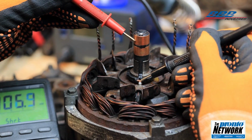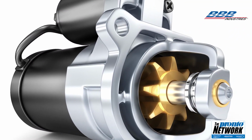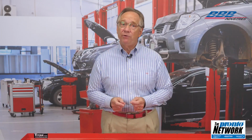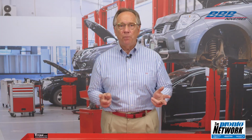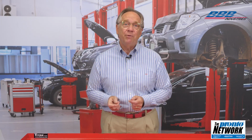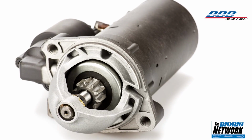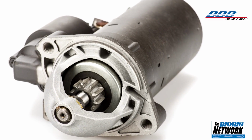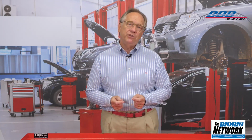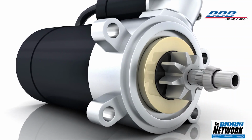Starter failures are not very common these days thanks to fuel injection, but they still can happen. If an engine won't start for whatever reason, no fuel, bad gas, no spark, or no compression, and is cranked continuously in a futile attempt to bring it to life, the starter can overheat and fail. As with alternators, the cranking circuit needs to be thoroughly inspected to rule out all of the other possibilities before replacing the starter. Starters also need to be bench tested to see if they are good or bad before a new unit is installed.